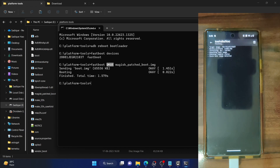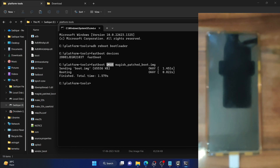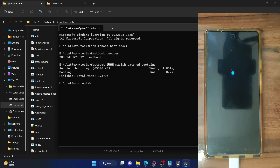Launch the Magisk app. Tap on Install next to Magisk, then select 'Direct Install (Recommended)' and tap Let's Go. It will now patch and flash the boot.img file permanently. Once done, tap on Reboot. Your phone should now reboot to the rooted OS and this time root will be permanent. Note: if you are seeing a subsequent delay in every boot-up, I recommend doing a format data or waiting for the next OTA update to fix the issue.